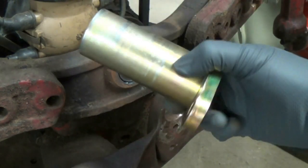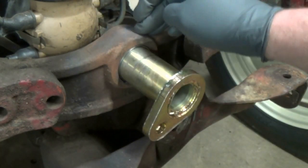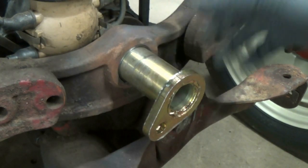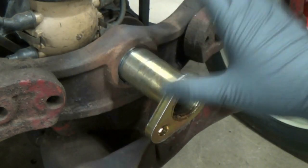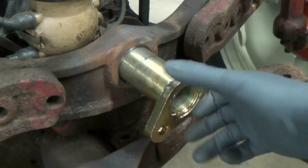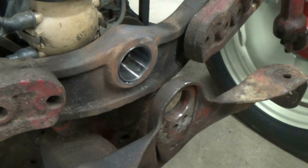Here's the new pin. These are dry pins, meaning there's no grease fitting on them — you can't grease them. The whole theory behind that is grease and oil attract dirt, and dirt is abrasive. This is a very enclosed area and there's a lot of dust, so their theory was to keep it dry. I put an oil can to it every now and then because they do squeak, or even some liquid wrench or WD-40 helps out too. For the most part they do last a long time even if you don't grease them.